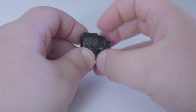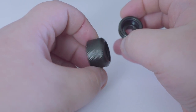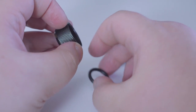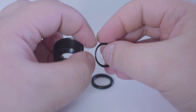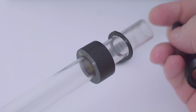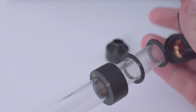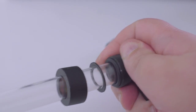I'm going to quickly explain how the compression fittings work. As you can see there's two pieces: one that gets fixed onto your rad, pump or water block, and the compression sleeving itself, which is 3 separate pieces on these AlphaCool models. The sleeving is the first that goes onto the tubing, followed by the metal washer and lastly the gasket o-ring. The idea is that the sleeving will clamp down on this o-ring and tubing, creating a tight seal, not allowing water to permeate. It's really basic if you think about it, but it works.